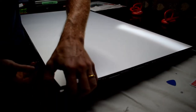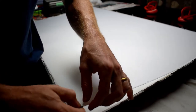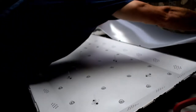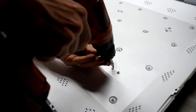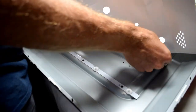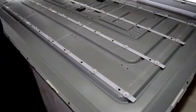Just put the screen on a cloth — I use a bed sheet. Underneath that there's another plastic bezel that you need to remove. Then we can remove the filter pages — the filters. I tape them together with electrical tape; I like to use electrical tape because it's not so sticky. There are these little plastic holders that are screwed down, so unscrew them. You don't need to take off those plastic holders because they're actually glued to the plastic sheets. Then we can remove the white paper underneath.